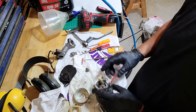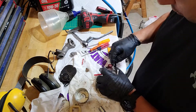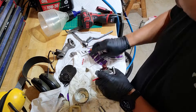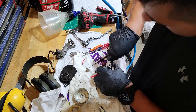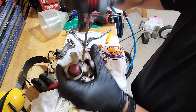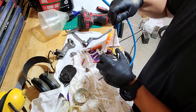Now that we've almost got everything out, there's one more thing — there's a black cap on the side. I'm going to pry that thing off. However you've got to get it off — usually a pricking tool works, you just stab into it and then remove it. There's the black cap. Take a flathead screwdriver — there's a brass fitting. Take this jet out as well.